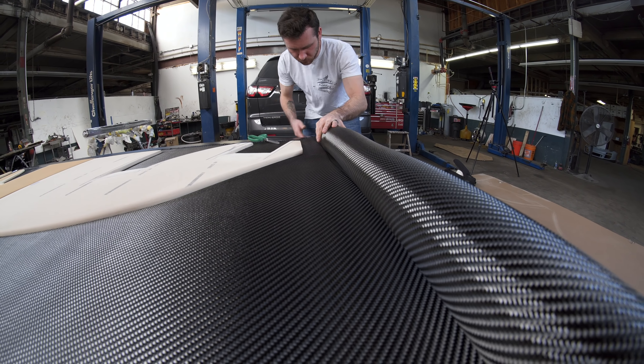I'm adding in another piece of 12K on the bottom, just for the section where I'm actually going to mount the splitter. So we've got our 12K down, two pieces of foam flipped upside down — so this is the bottom. This way it'll basically have 12K, foam, another piece of 12K, and then carbon Kevlar for the actual surface that's going to mount.